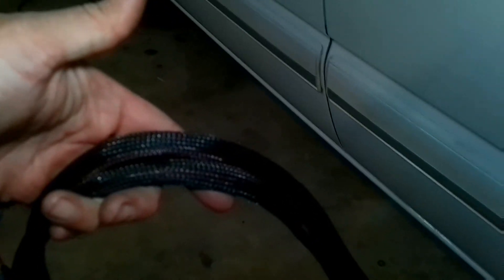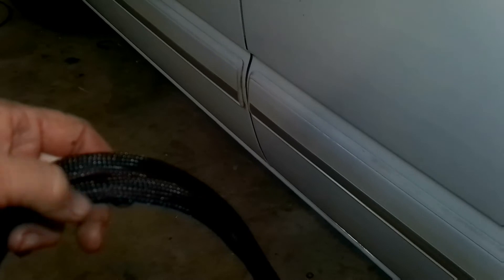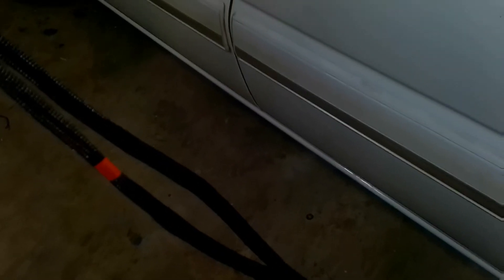When you've got electrical lines or fuel lines and you're running two similar style lines together where one does one thing and one does another, do yourself a favor and put a piece of red tracer tape on it or something like that, especially if they're loomed up. Because if both of your lines are secured up and all you see is loom, you don't know which one does which. That's a helpful little hint right there.